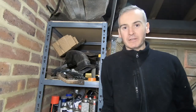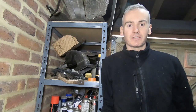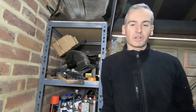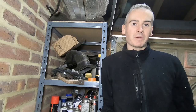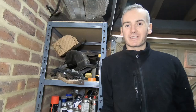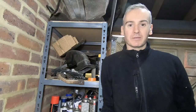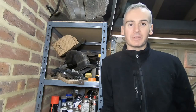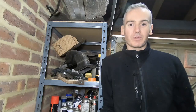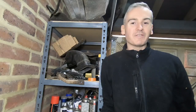So what I'm going to move on to now is building out a control panel so that I can send the necessary signals to the inverter to turn it on, to set it to run, to set forward, reverse and whatever, without doing what I've been doing in the past, which is basically just touching various wires against the positive on a 12 volt battery. So we're going to build out a control panel, get some switches in there that will allow me to decide when to send those 12 volt signals to the inverter and do it in a safe and secure manner.